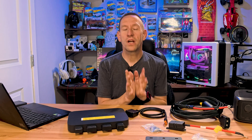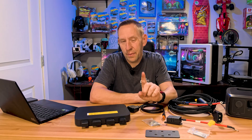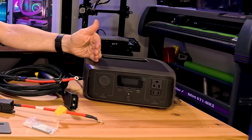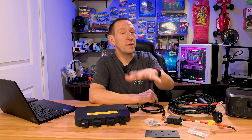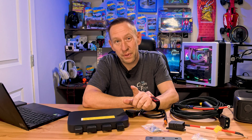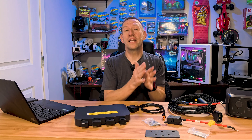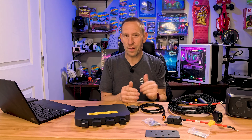Most of us are using a cigarette adapter, which you can plug into any vehicle. The limiting factor is that the cigarette port can only charge at a maximum of 100 watts. So something like a larger Delta series power bank is going to take many, many hours to recharge. I've even had one where the power completely depleted and I couldn't recharge it fast enough — I had to run my truck for hours on end charging at 100 watts, which was horrible.